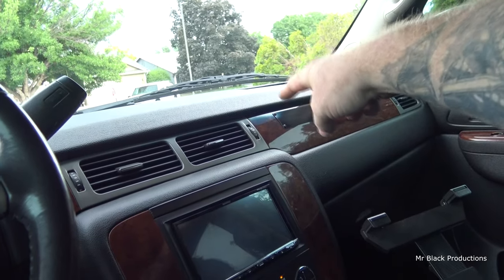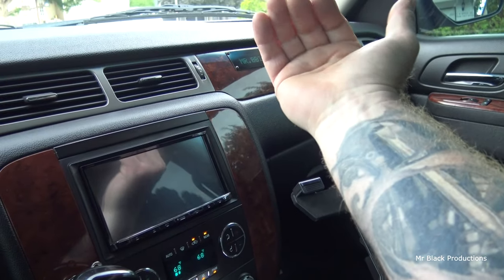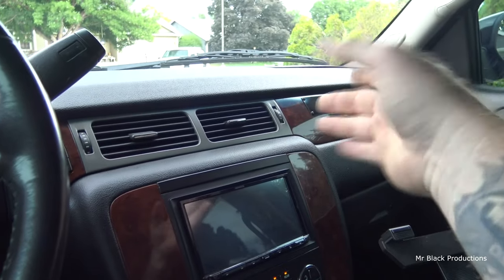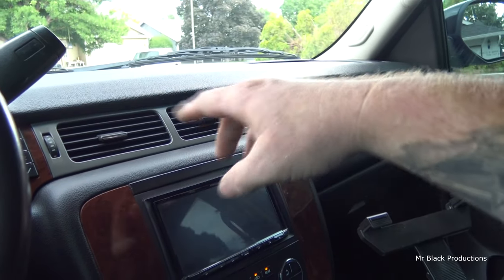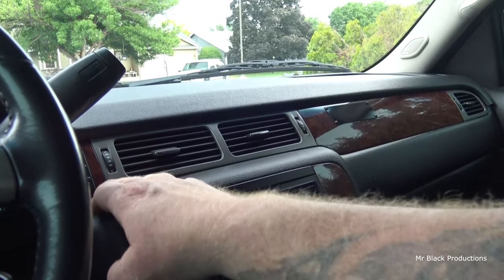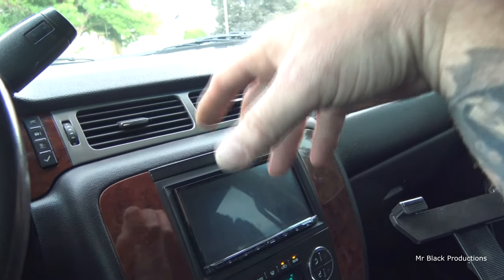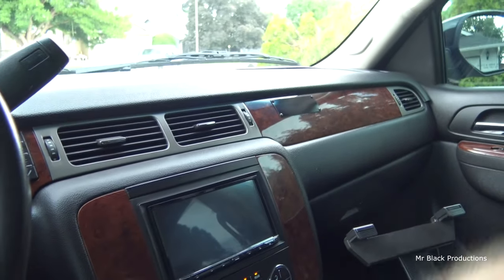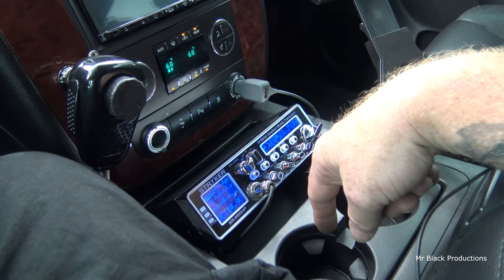Routed the cable around after supporting the cable to this plastic bezel on the front because I didn't want it to move. Vibration at that joint would have been a killer for this thing. So I secured the cable to this, then I plastic welded all of this back together. It sounds like I'm so smart or some such. I literally took a soldering iron and just remelted the joints back together, the round pin nut joints that hold this whole thing together. Put that all back together and rerouted the cable down, brought it around, and sitting down in here underneath the center console is the LP100 box itself.